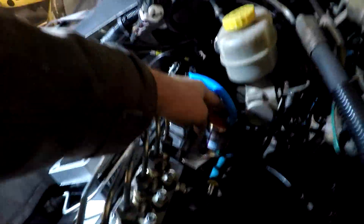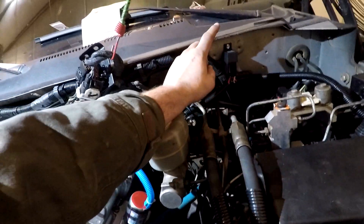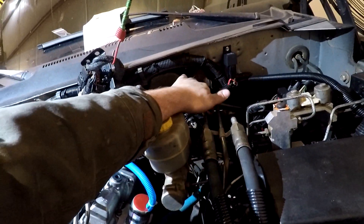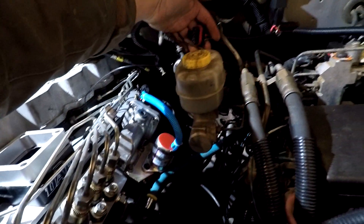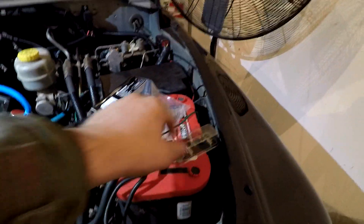We did get the new shutoff solenoid put on there — it is made by Larry Bees. They have a very nice and simple-to-use wiring harness with an 80-amp relay. So instead of using the 12-valve wiring harness shutoff solenoid, we use the Larry Bees solenoid harness which runs right to your fuse box for key-on power, and we tap that into the starter wire right here — which we still have to seal up — and then we have a power and ground that goes right here.